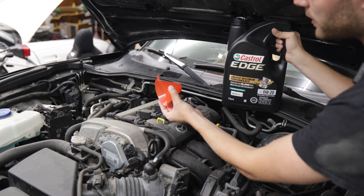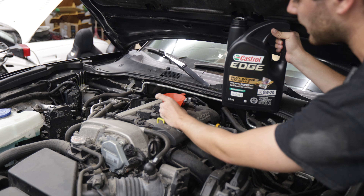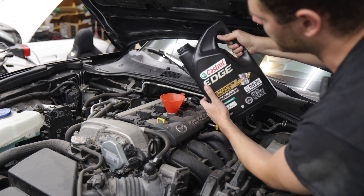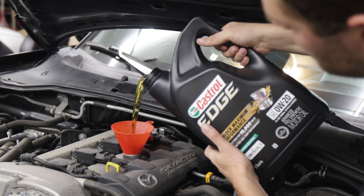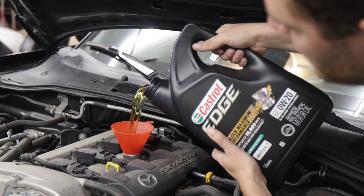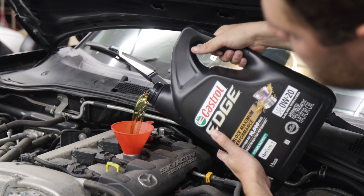Last thing to do is fill up the car with oil. I cut down this Harbor Freight funnel and you can just drop it right in place — that helps it fill a little bit faster, but any bigger funnel will work. This car is going to take about four and a half liters of oil. I'm going to put four in right now since I already pre-filled the filter, then we'll lower it to the ground and see where we're at.